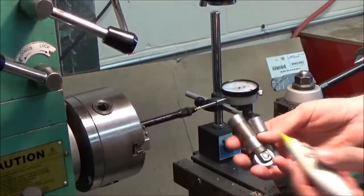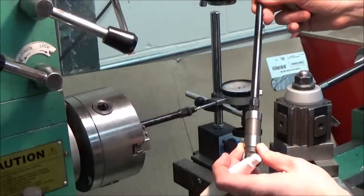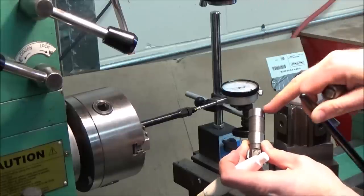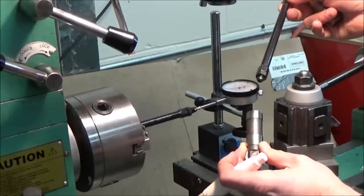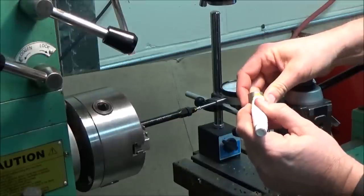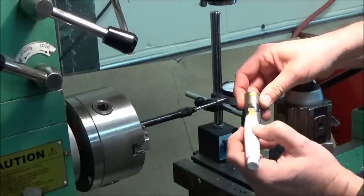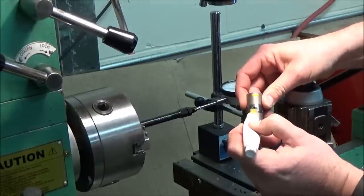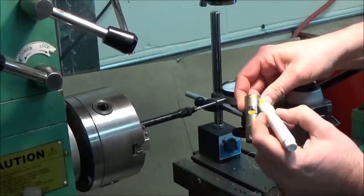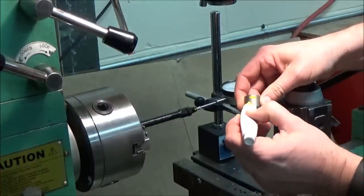I made a reference mark on here and went ahead and grabbed a lifter. What we're doing is setting this to where the pushrod is going to sit in the middle of this distance — that's what we're doing when we're adjusting. What we know about these lifters is from where it just touches and it's a little bit below the top surface to its full travel length — this isn't per scale — it's 200 thousandths of an inch on average.